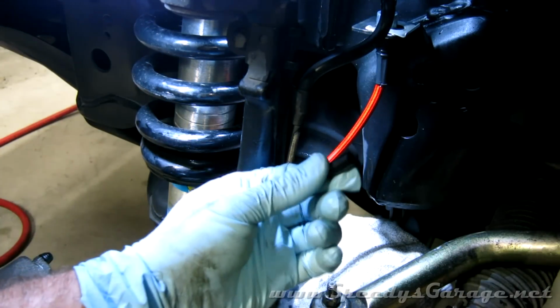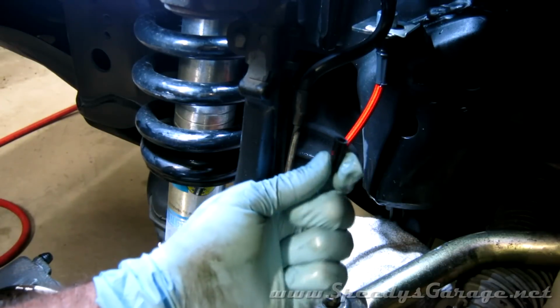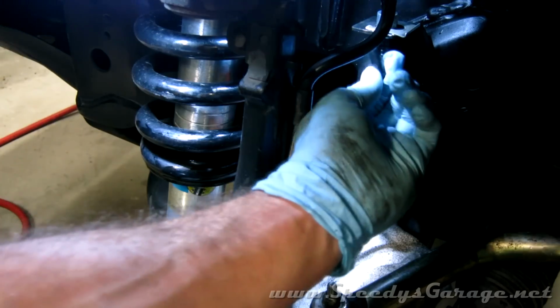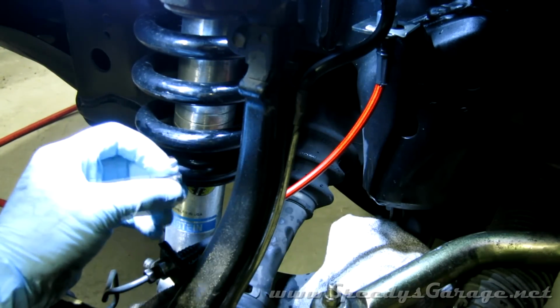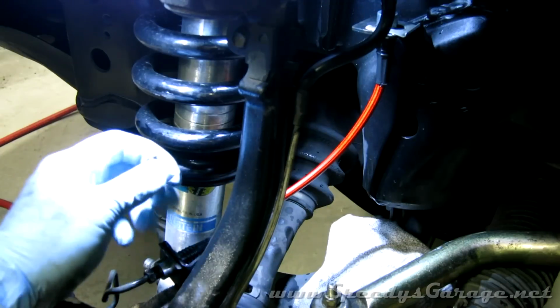When I got to the top and took it off the top connection, obviously brake fluid is dripping out of that at a constant rate. A 3/16 vacuum plug will snap right on the bottom of that hard brake line and stop the leak. And that gives you time to work without having to rush and be all jittery about it with brake fluid going everywhere. Make sure you've got plenty of rags on everything to catch any drips.